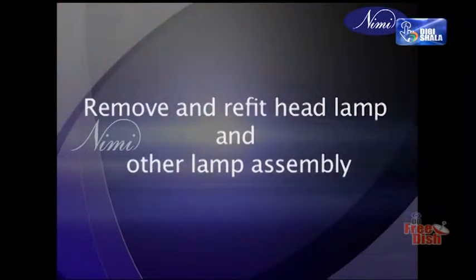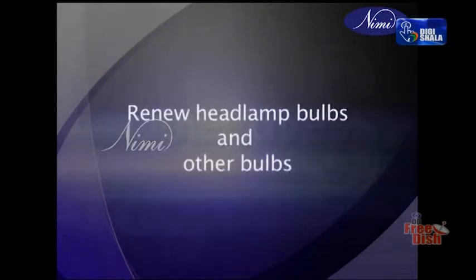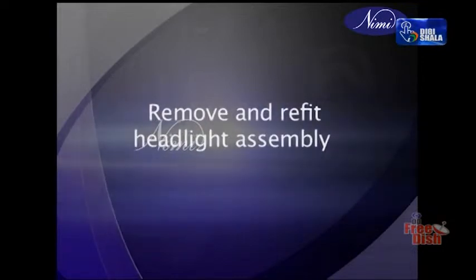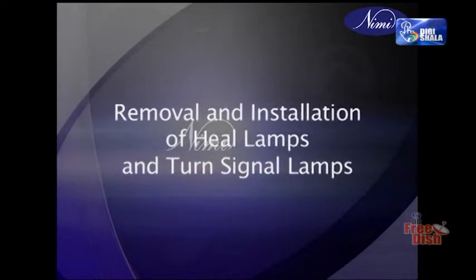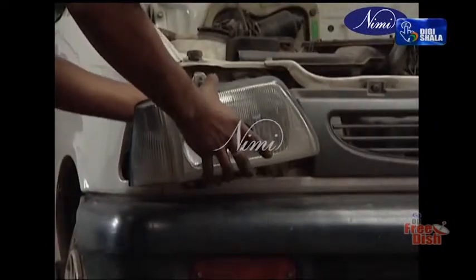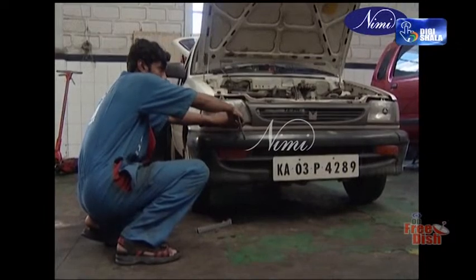Remove and refit headlamp and other lamp assembly. Objectives: renew headlamp bulbs and other bulbs. Remove and refit headlight assembly. Removal and installation of tail lamps and turn signal lamp. Disconnect the headlamp connector. Installation is the reverse of removal. Caution: do not touch the surface of the bulb with hands or dirty gloves.